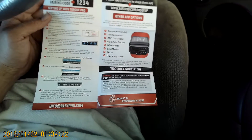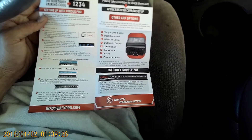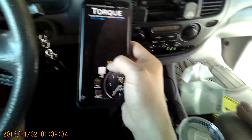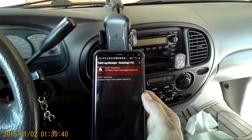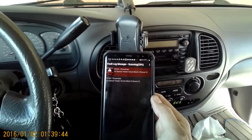But I don't know what my fault codes are. So how do I go do that? I think I'm connected now because that's no longer flashing. You have to tap to request fault codes. So it looks like my O2 sensor heat circuit bank 2 sensor 2. So I have a bad O2 sensor.